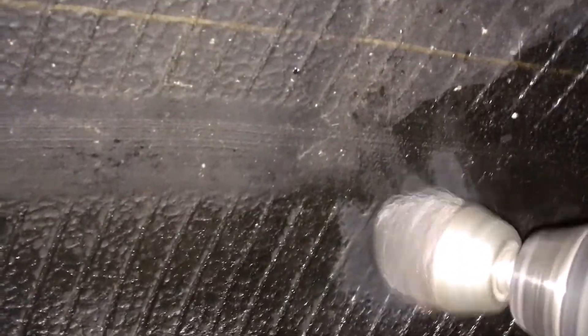Now I'm going inside the tyre and I'm using a wire brush. I need to achieve two things: I need to take these internal ridges down so that there's a flat surface for the patch to stick to, and I need to roughen the surface up so that the adhesive can get a good grip.